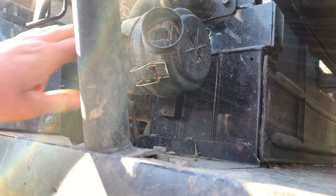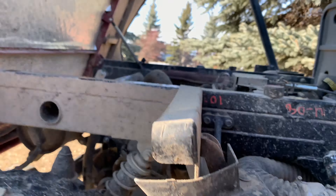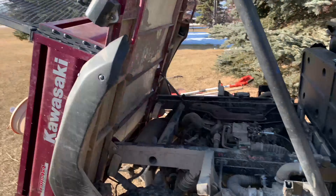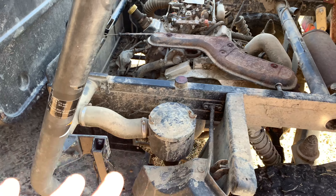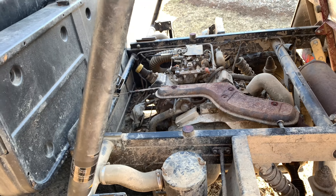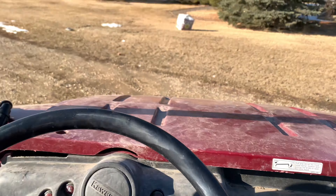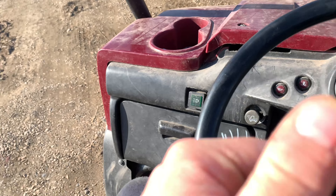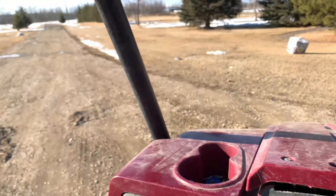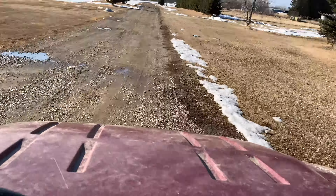Here again is that old plug, and the new plug going in the hole. I always cinch down this hole a little bit and we'll get this plug in and tighten it down. With these ones I do tighten down a little extra because these crush washers have never been crushed. You can actually hear the crush washers crushing down — so that's about good there.